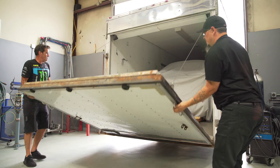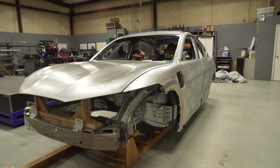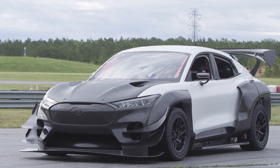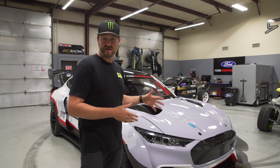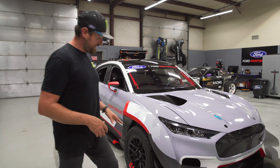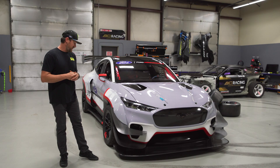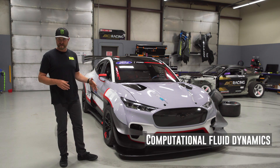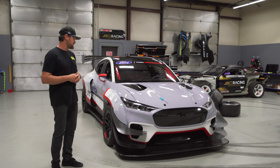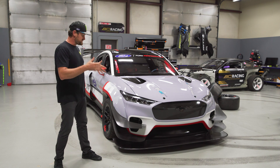This vehicle was built off of a Mach-E unibody, however now most all the panels that you see are carbon for obvious reasons — light weighting and strength. Most all the carbon was made in autoclave. Moving down you can see a lot of really beautiful carbon work. The entire front fascia is carbon for performance. We did a ton of the aero work — everything was done in CFD. As you can see, massive canards, huge front splitter, and all the ducting that you see is for functional cooling.